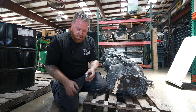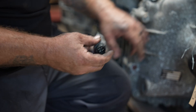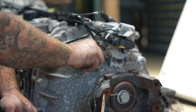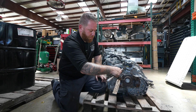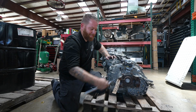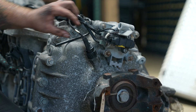But if you don't see that, what you want to do is put a little clean oil or threadlock. Remember guys, lefty-loosey, righty-tighty — all you do is put it back in. I love to start with my finger, not just put a tool on it right away, because you want to avoid cross threads. Back with the crescent wrench, get it snug and a little turn, and that's it. Then you put your plug back on — just twist and it snaps right in.